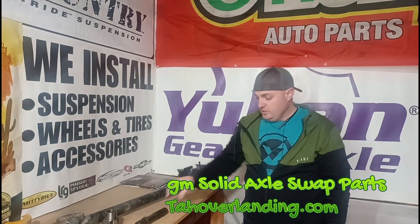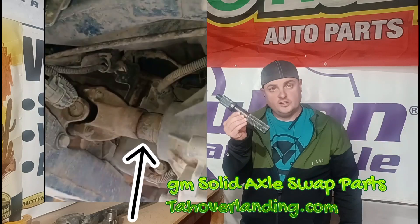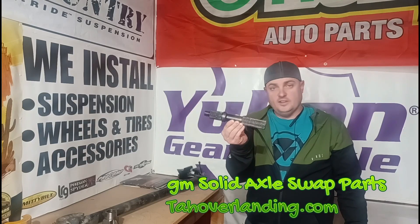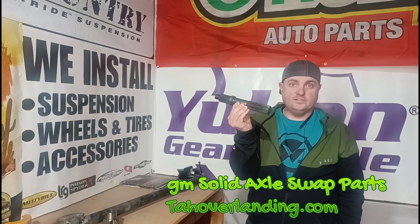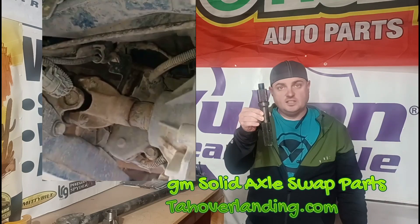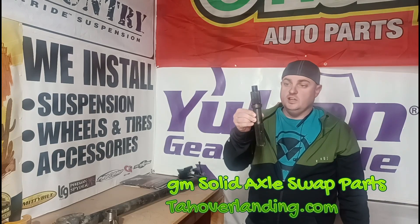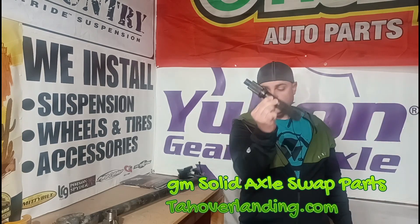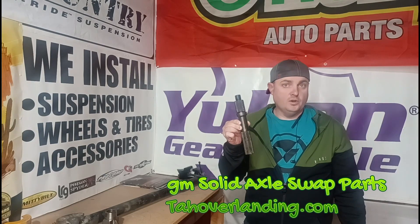With our setup you need to slip this in and around this collar here and actually weld it — just tack welds, no major welds. Doing that prevents vibrations, because if you don't weld it, it vibrates a little since it moves ever so slightly. You weld it to the output shaft of your transfer case, which then leaves this much sticking out, basically converting your electric shift transfer case to a standard style output.